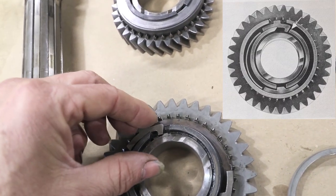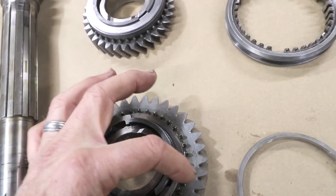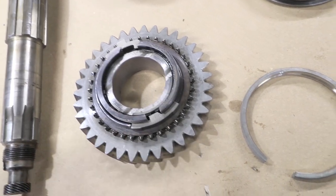The workshop manual shows that this angle lines up with this cut right here, and then this ramp goes on that side. You guys know I'm building two transmissions — I'm going to put this one together with the old parts. The new transmission I'm keeping for my higher horsepower engine build will be fully upgraded with all the latest synchro parts. The first gear has a different stop block — it's still one energizer band but it goes all the way around. As the years went by the Porsche transmission became easier to shift into first. The dog teeth instead of being symmetrical like a little tent are just slants, so the sliding sleeve, dog teeth, energizer bands — all that stuff gets replaced with updated parts.